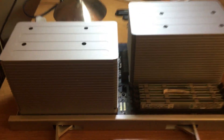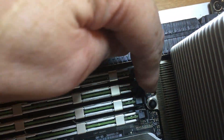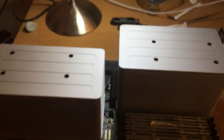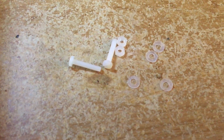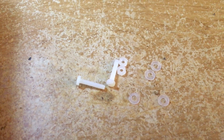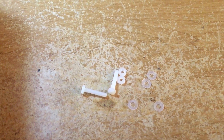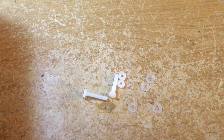So here's the processor board. You can see down there — one little clip there, and there's one under this heat sink. I'm going to remove the heat sinks and I'll come back to the video. I've got these: four washers, two little nuts and two little bolts, which are made of nylon plastic, so I can replace the clips. I'm going to use the original springs as well.